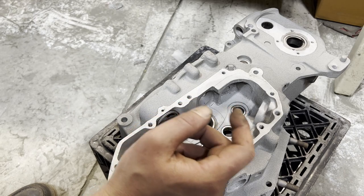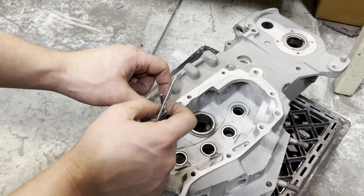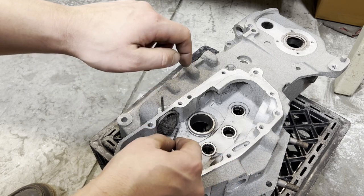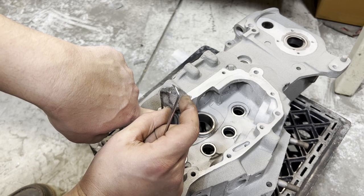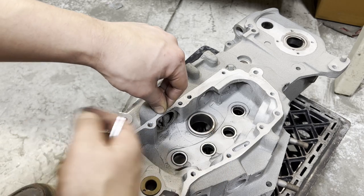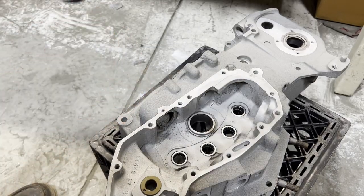Here's what happened: there's a little set pin in here that drops through and holds the screen in place. I had nothing that would grab it — sometimes you can put a magnet in and in a perfect world your magnet will catch the pin and pull it out, and the whole thing comes out as one piece. That was not the case today. So what I did was shove a pick through here, broke the screen out of the housing. Here's the screen — there's the hole where I punched it right underneath the pick. Once the screen is out, the pin goes through the hole in this plate. Once the screen's out I can grab the pin with needle nose pliers, slid it up just a little bit, then it came free. Now this comes completely out and we can replace that with a new one.